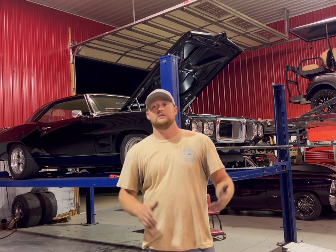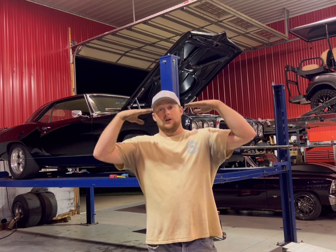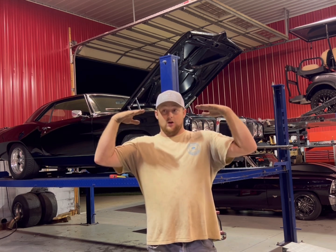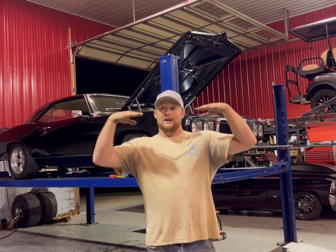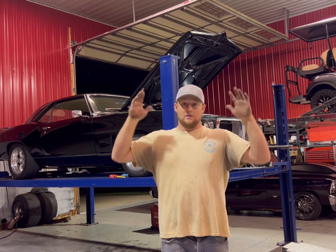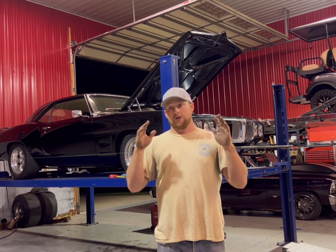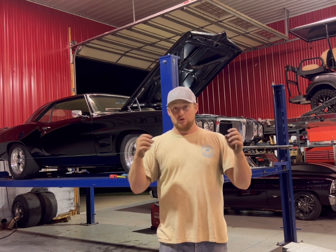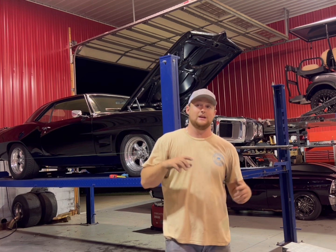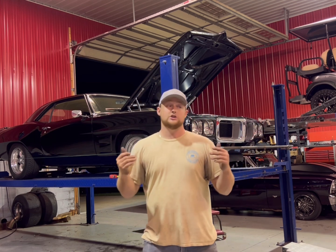And a lot of cars that are neutral at ride height, especially if the geometry of the steering arms, whether it's gearbox or rack and pinion, or if they're at some odd angle, because that's another thing too, when you're doing this, if you keep getting these odd measurements, like, oh, every time I lift the front of the car up, this thing goes crazy toed out. The steering arms may need to be moved on the spindle in relation to height. And plenty of people make kits to move them down and move them up, and you can read all about that for days and just try stuff.